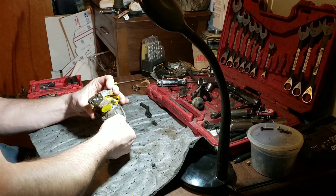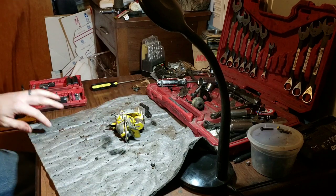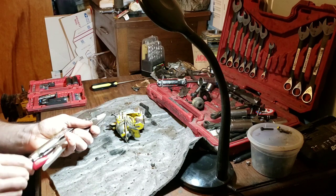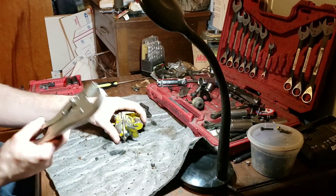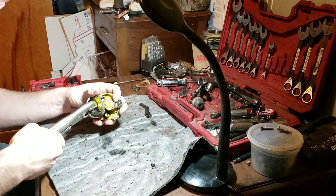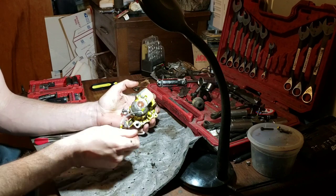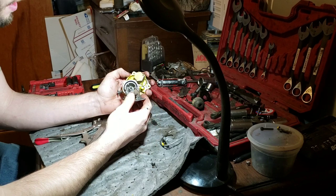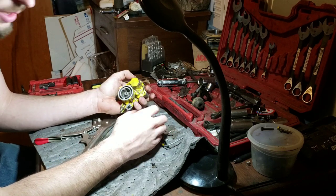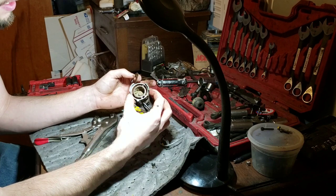I haven't seen a one-line feed except on the 320 and 325. What you do is undo that. Need some bigger pliers here. This is one of those bail holder clip things — just reverse that, pull that down, and you can actually pull this out. Separate it — and voila, you are inside. This one does not have a filter in it, so somebody removed it or it was never put in.